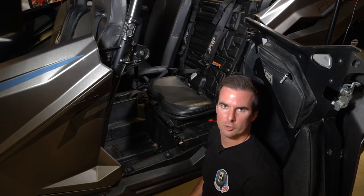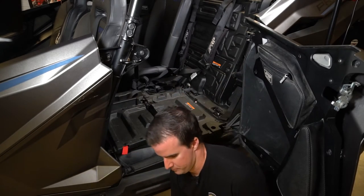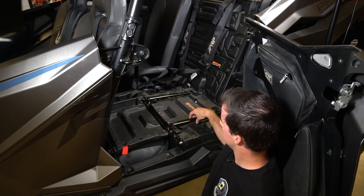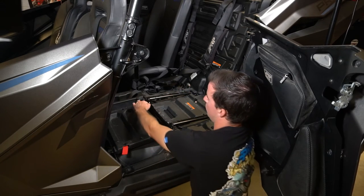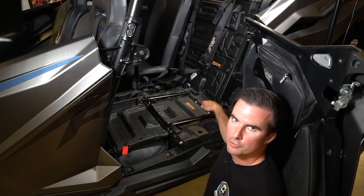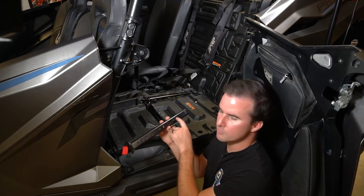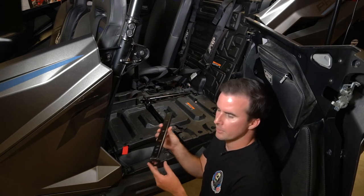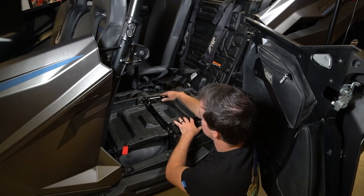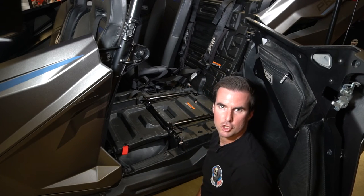Installation on the bottom portion is just a little bit different for the fixed seat variant. Rather than having a folding bracket, you're going to have two fixed brackets that go on either side. To remove your stock seats, take out the two bolts on either side in front and the single bolt on either side in the back. Then take off the bracket from your stock cushion using the same Torx bolts, and reinstall it on the bottom of our PRP cushion. After you have it on there, put both of those back in, then reinstall the four bolts in front and the two in the rear using the stock hardware.